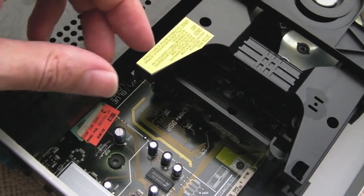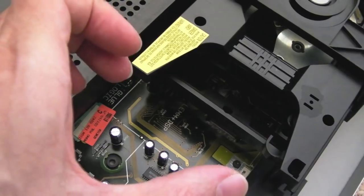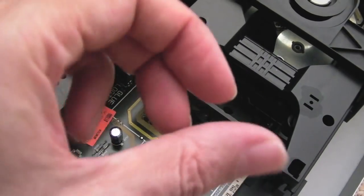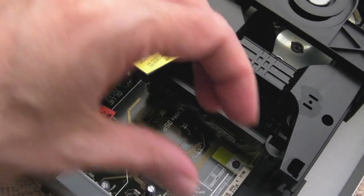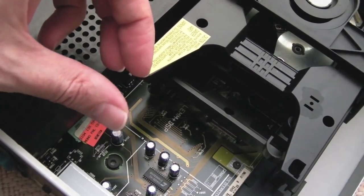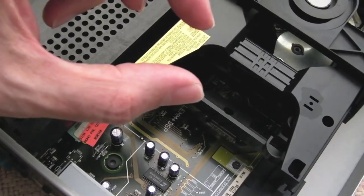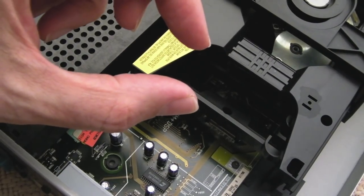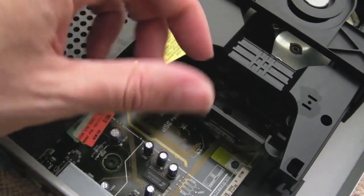The other thing you can do, there's a battery. What it is is a dip chip. You'll see it when we have a look in a minute. But it's a dip chip with a battery on top of it and a crystal, and then they've encapsulated the stuff on top of the dip chip, if you see what I mean. So it's like, I don't know, 3 or 4 times as thick as a dip chip, but that top 3/4 of it is just a solid plastic filler to contain the battery and the crystal.